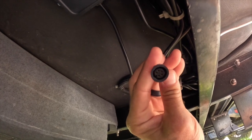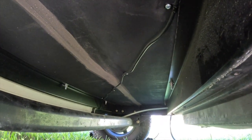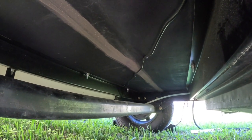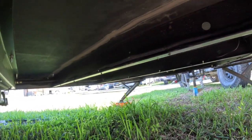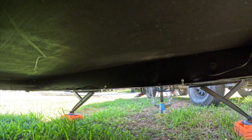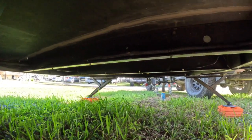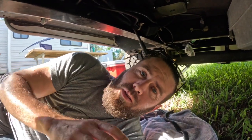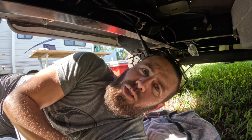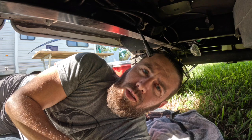You can run your light wherever you need to. Here's where I had to run a few of those little P clips to run the wire at a diagonal angle, and here's an example of running it across the frame rail right here. You can zip tie it — there are actually quite a few mounting holes on the frame rail that make it very accessible to run wiring and secure it. I spent a little time underneath the trailer securing stuff, but a few zip ties, some P clips, and some screws, and you can very easily secure all the wiring.